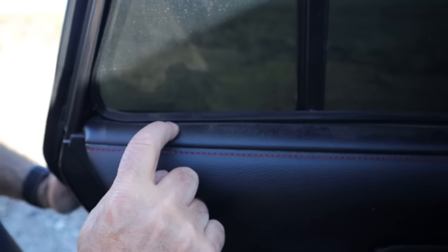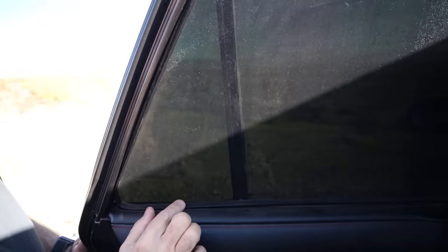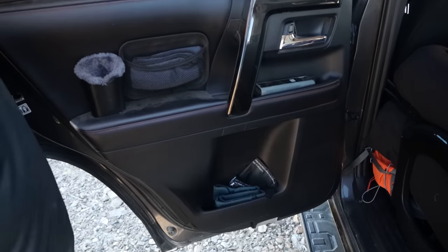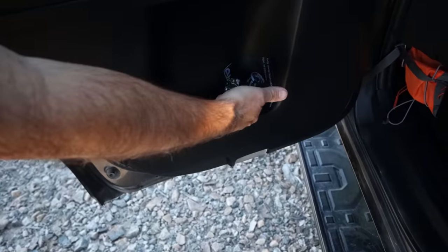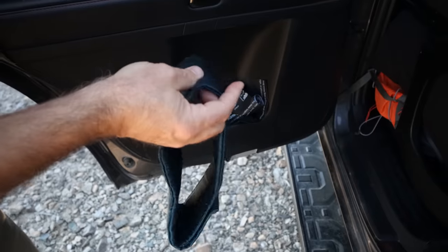On the outside of the vehicle I have wind shades so I can lower my window partway. On the inside I made screen inserts from half-inch by eighth-inch aluminum from Home Depot — manually bent to the shape of the window frame, with screen stretched over it using a hot glue gun. It stays in place with rare earth magnets, so I can get a fresh breeze at night. I utilize all the door space: flashlight, a place for glasses, a cleaning towel, biodegradable trash bags for my toilet, and eye shades for sleeping in bright Walmart parking lots.